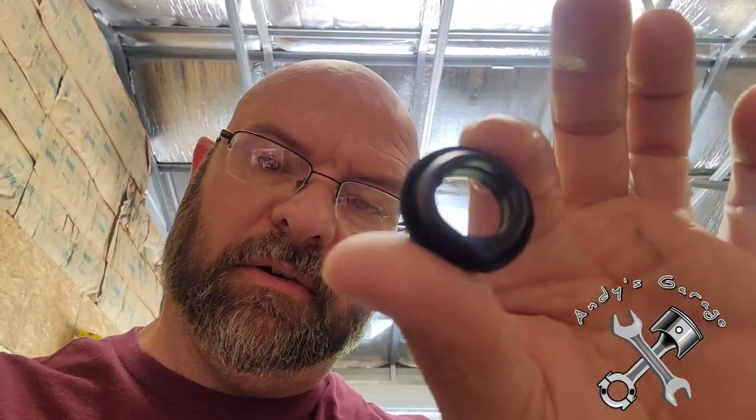I'm going to get started on this. For starters I need to do a layout on the rear of the gator so I know exactly where I need to drill my holes for the lighting. On all of these lights they are three-quarter inch - just get a three-quarter inch drill bit, drill the hole, pop the grommet in, then pop the light in, then do all your wiring. Let's get started.